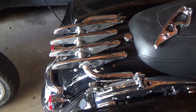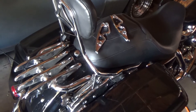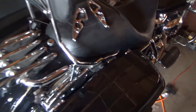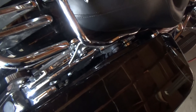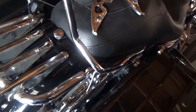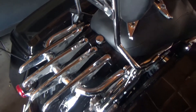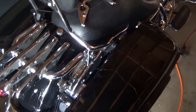Here is the Harley-Davidson backrest installed. The front slides up here at the shock mount and the back clicks on to the docking station front post. This is why you need to put the front post towards the front — so it'll work with the luggage rack and backrest, as opposed to putting the short end in the front. Like I said, the instructions didn't say that, so there it is.